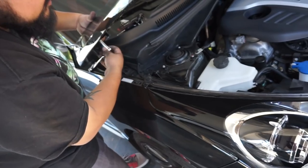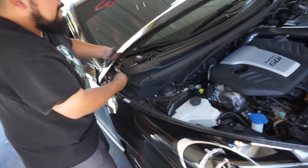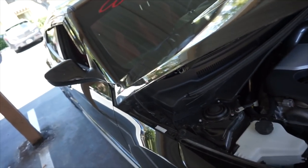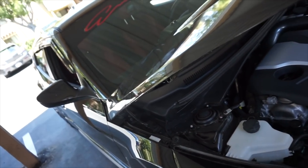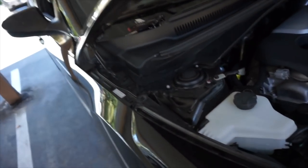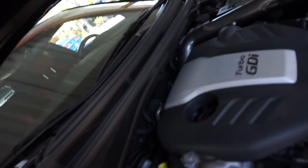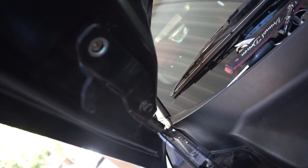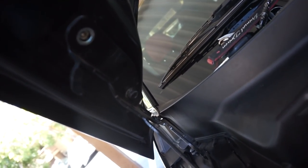It is going to be inconvenient for a little bit — I'll probably get those ordered in the next week or so. In the meantime, we're going to basically bolt on the new carbon fiber hood, make sure the fitment's right, and it should seal relatively easy. This is definitely going to be a two-man job just because the stock hood is a little heavy. So you're going to need some help to basically take it off, and then you might even need a third person to hold it steady while you align the two bolts. What we did first is we basically installed the lower bolt. The top bolt isn't on yet — did the same thing for the other side just to kind of test fit, make sure it seats. Then once you're lined up, put the top bolt on each side and tighten everything accordingly.